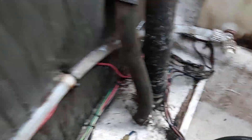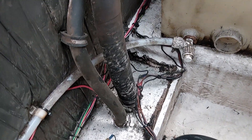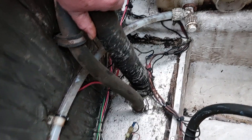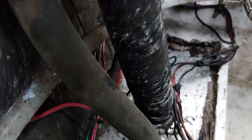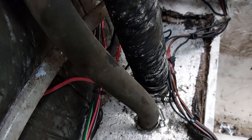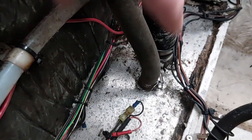This is what I'm actually going to show you — everyone checks the fuel lines, but the number of people who forget to change or check the fuel filler hose into the tank. In this case, this is actually in really poor condition and it's got a lot of splitting of the casing, which is probably why when I lifted the lid on this compartment I can smell quite strong vapour — it's all coming from the splits in this hose down here.